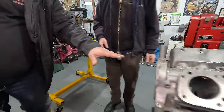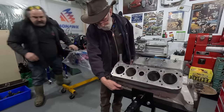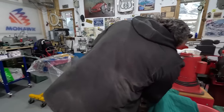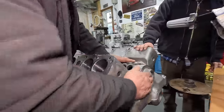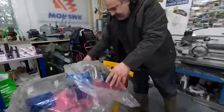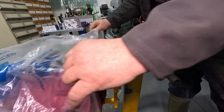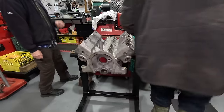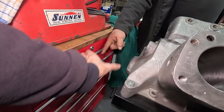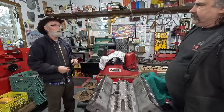This motor is the same but different — very interesting. This is your center line here where it's bolted onto my stand. There's no bell housing — see right here? There's a bell housing on this motor here — how this bolts onto the bell housing. Your transmission and accessories go on here. This here is just a shaft that comes out — your flywheel is going to sit right in here, and you run a jack shaft from your flywheel to your transmission. Well, they think that's a new thing — it's like the new Corvettes have the motor up front and the transmission way back there. But that's so old.